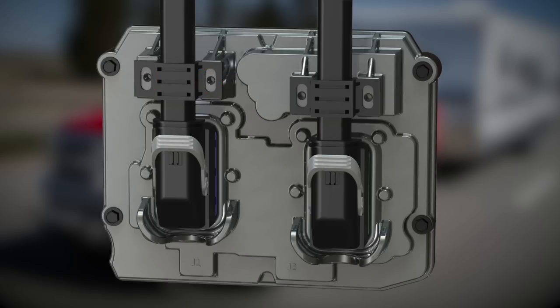To disconnect the PCM wiring harnesses, you will need to depress the button located directly below the gray release lever. Failure to keep this depressed while lifting the lever could result in damage to your PCM. With the button on the rear wiring harness depressed, lift the lever to release the wiring harness. Pull the plug free and push the harness out of the way.